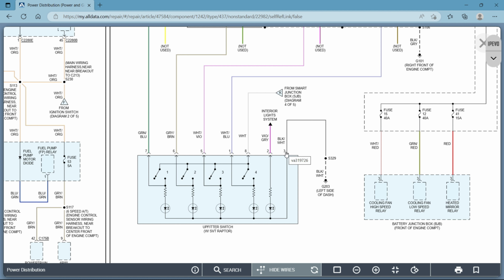Okay. The number next to the component is the pin number. This one obviously only has one connector going to it. Otherwise, it would give you a connector number somewhere in the corner. This little arrow here pointing towards the wire means it's a male connector. It is a connector. That's what this arrow and this arrow means. But there are the differences between the male and female connectors. Okay.